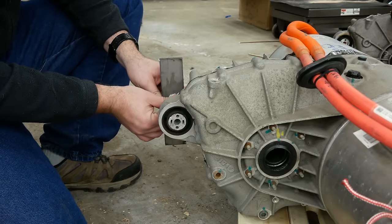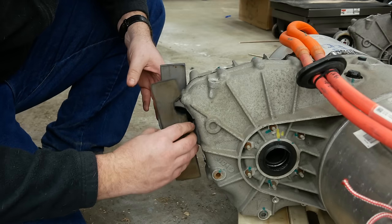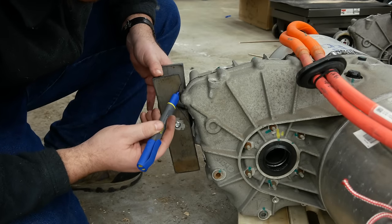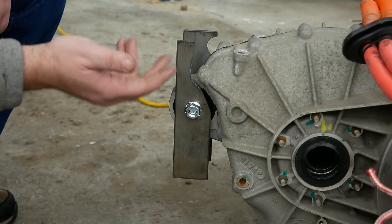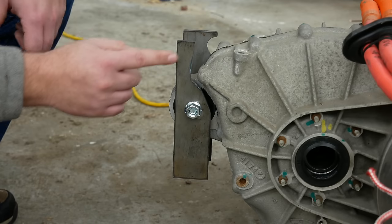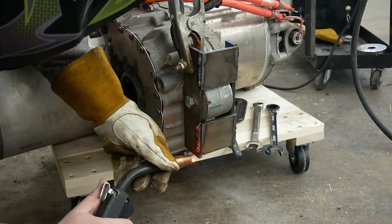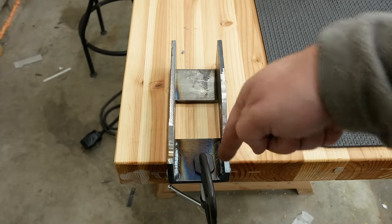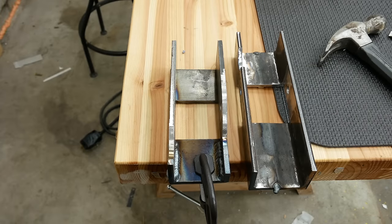I am officially bad at this. There's not enough clearance here — it will clear, but just barely, and there is nowhere near enough clearance on this side, so I need to cut here and here. The geese also agree that I'm an idiot. After seemingly endless clearancing and retesting, I ended up with this shape. If you're thinking that looks awfully spindly, just remember this will be braced on multiple sides, welded in place, and made out of steel about twice as thick as is actually necessary.